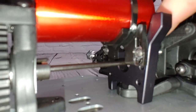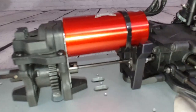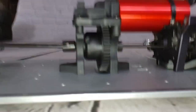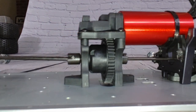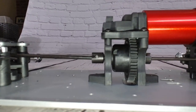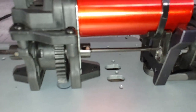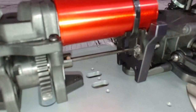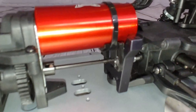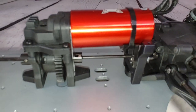With this one there's no gap at the motor — this is completely tight to the motor, these are locked down tight, that motor is not going anywhere up or down. It's not going to bend that little piece of aluminum that is technically the motor plate. It's an awesome setup — Mitch came up with an awesome design and it definitely holds tight. It really changed a big part about this truck, which was that adjustable motor mount that sucked. This is so much nicer, so much tighter — even if you bought it and only put that piece on, it's still better motor support.